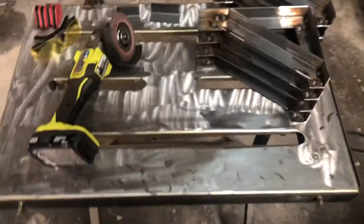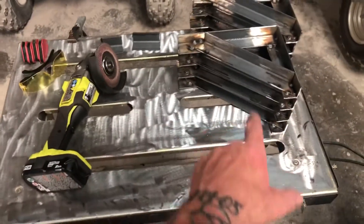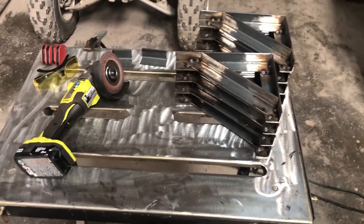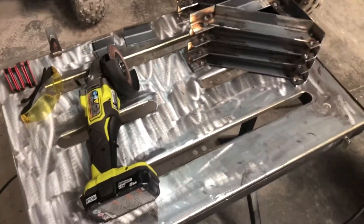It's an absolute disaster — but on purpose. I took it down to the studs, basically all the framing, taking the entire floor out. New floor, new outriggers, new wood framing in portions that had water damage, new front end, brand new exterior metal, brand new interior panels. Most people think I'm nuts, but I bought it really cheap and I'd rather put the money into it and know that it's done right.